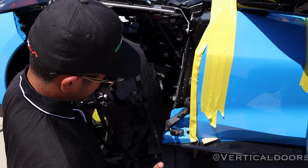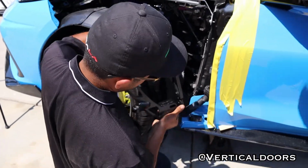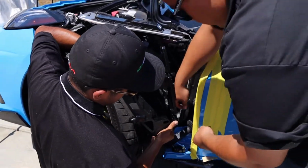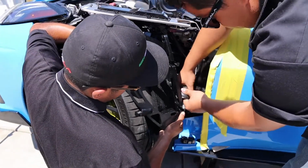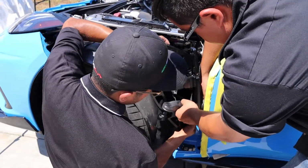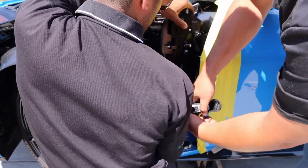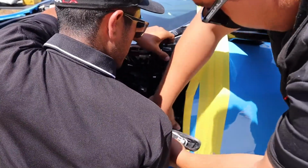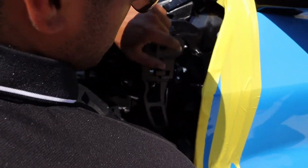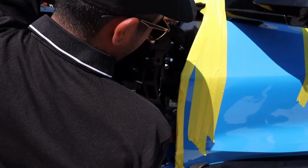Now comes basically what we've been waiting for this whole time, installing the bracket. So go ahead, feed the wire through. All the way through, even past the boot, just to make sure that nothing gets kinked. Now, when installing these kits, it is crucial to always install the bolts on the door first before putting them on the ones holding it to the frame.